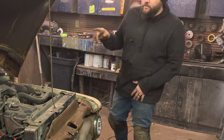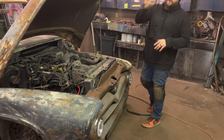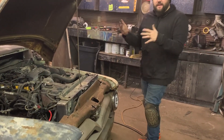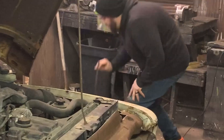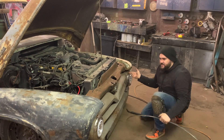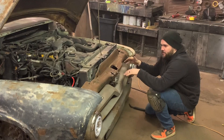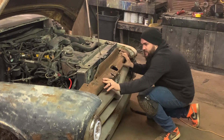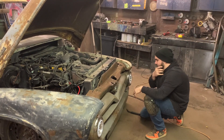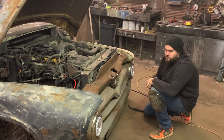I need to go get some sheet metal to finish off the dash. I've got sheet metal in my other shop, but before I go down there I think I'm going to figure out how I want to do this tilt hood because I've got a bunch more steel down there. I got some heavy duty hinges from the hardware store and I think I'm going to run a piece of eighth inch flat bar right here to connect my fenders together. When the hood goes down I should be able to build off of that bar, and I can also tie it in to the radiator support — make it all strong enough to put some hinges there and have my tilt hood. Let's cut some stuff up real quick.